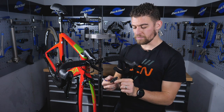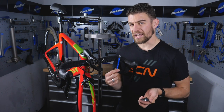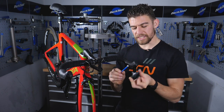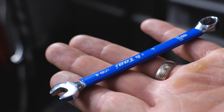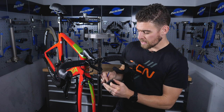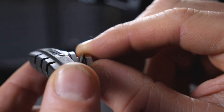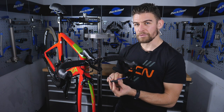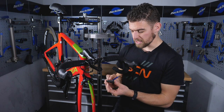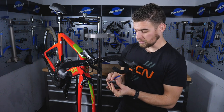Now first off we're going to focus on the brake blocks — the one piece item. Traditionally these will be removed with either an allen key or, as this one is, with a spanner — an 8mm spanner in this case. These are mounted on the side of your pad and they have the adjustability built into the collar and the washer system, so be careful that these washers are reapplied in exactly the same order as they're removed. You may find it easier to take pictures of this whilst you're doing that, or keep the instructions to hand from the new set that you've just purchased.